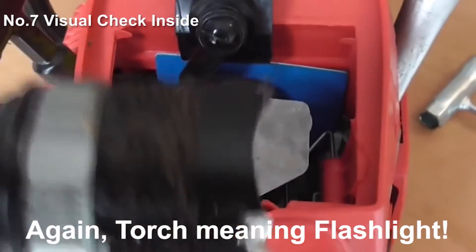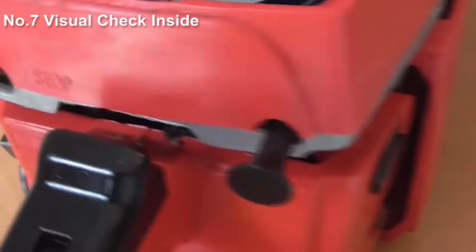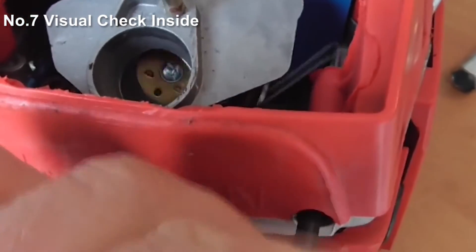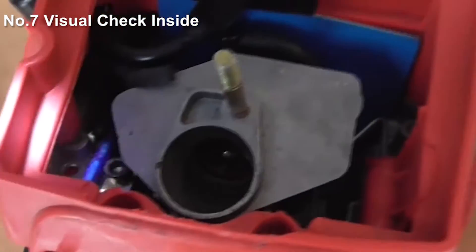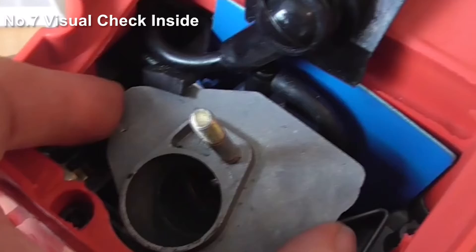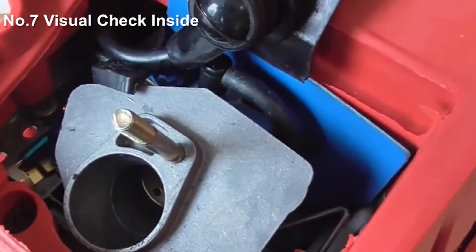I get myself a torch and have a look down there at the choke butterfly, making sure all around looks okay and that the choke butterfly is in a good state of repair. I'll pull the choke, pushing it in and out — it's operating via the linkage very well indeed, so there's no issues there. If the choke butterfly and the lever weren't working together this well, it could cause starting problems. It's also a good idea to have a look down the sides at the fuel pipes and all the linkages for any obvious damage, and just make sure the carburetor isn't loose — because if it is, it could be drawing in air where it shouldn't, causing starting problems.